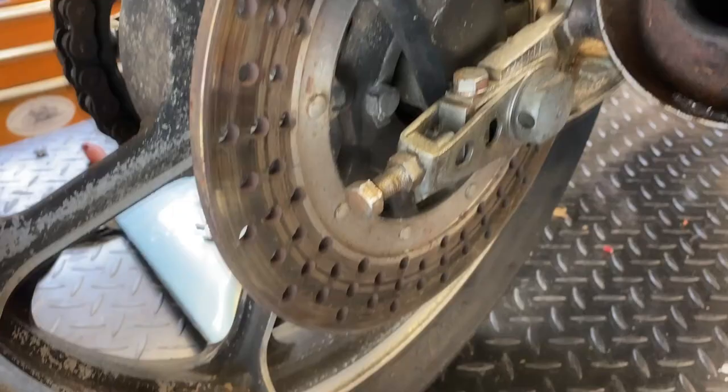Yeah, that's not fuel, boys and girls. That's definitely oil smoke. That's bluish oil smoke. I can smell it as well. So this thing's definitely pushing some oil. All right, let's do that. We gotta get some testing done.